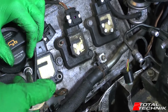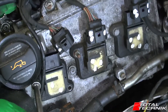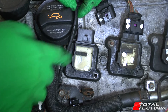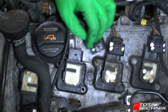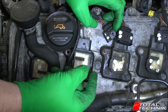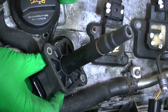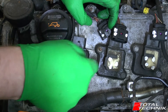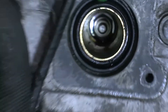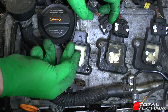All of these bolts are size 10. The bottom of the coil pack is like a stick with a socket in it that fits over the head of the spark plug. It's rubber inside so it's quite tight — it makes a bit of a seal around the spark plug. When you pull the coil pack off, that's the seal you're trying to break, and it can sometimes be quite tight.